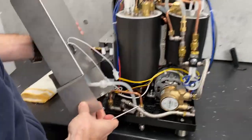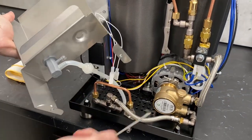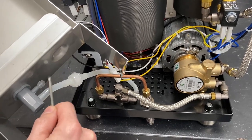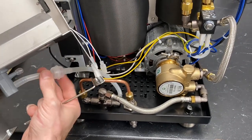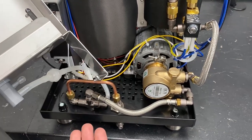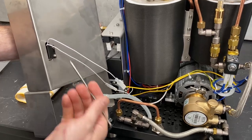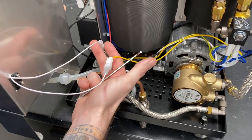This is not normally floating around — there are two screws that go through the bottom of the machine to hold it on. On the bottom here, this is the socket. You'll see two connections: one has just a blind cap on it; some machines have a return that comes to that point, but not on this machine. Right off of there, you have an inline particle filter, which catches any loose debris inside your reservoir. Swinging around the back, this is the back side of your sensor — a couple of bolts hold it on, and your wiring connections go to ground and board.